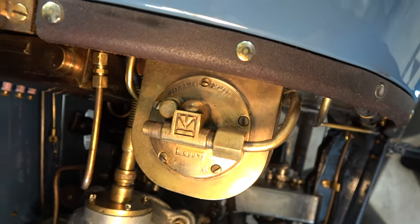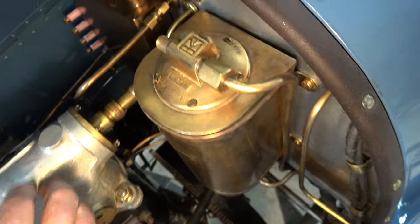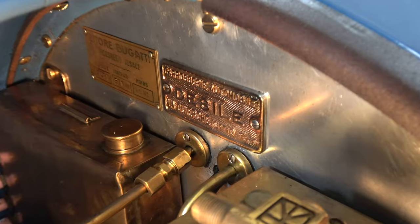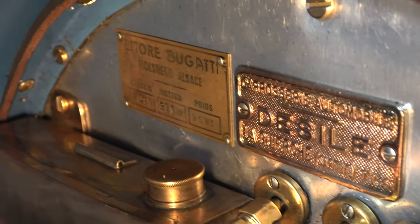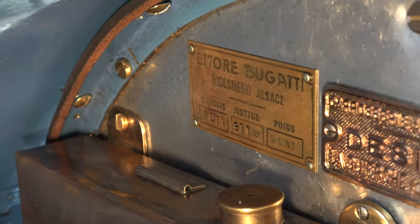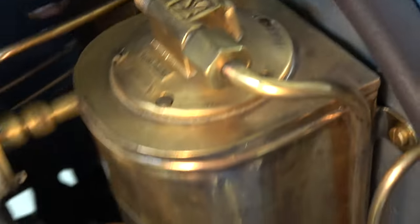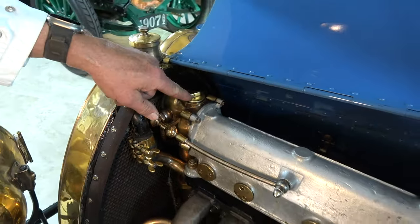This is your tach drive — it's directly to the dash, a straight line from the rear camshaft. It's an overhead cam, overhead valve, all-ball-bearing camshaft racing engine, so it's really high tech. And then this is your oil primer for your oil box — you would turn that, take that off and fill this up when you start.